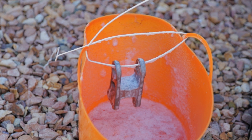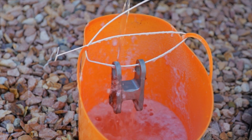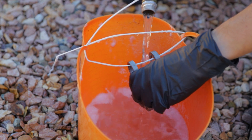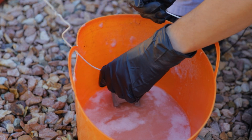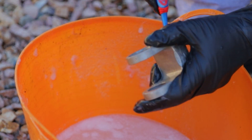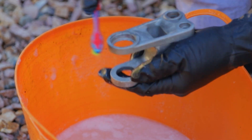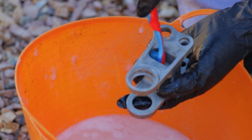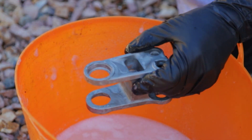It's been another 10 minutes or so — let's go ahead and wash off the oven cleaner. Looks like we got most of the color off, if not all of it. It did darken the material a little bit but don't worry, it all comes back once you start hitting it with polish. Most of it's out — I'm missing some spots in the inside, that's what the toothbrush is for. There's no orange anywhere except these little crevices, so I'm going to spray a little more inside, let it sit, and then start the polishing process.